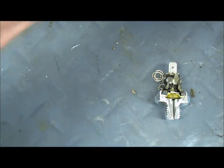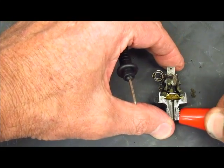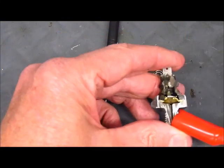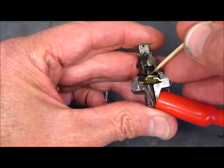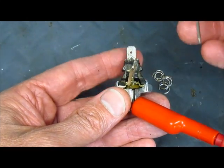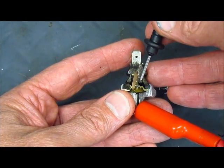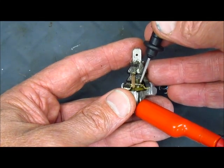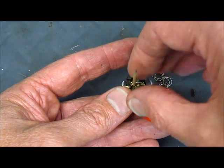Let's see what happens using the voltmeter set on audible to see how this really works. I'm going to clip one part of it to the base, then use a toothpick to help move the diaphragm. I have it so the diaphragm is down, just like it would be when the spring was working but with no oil pressure.